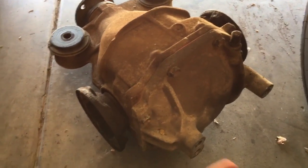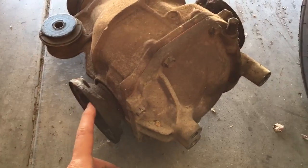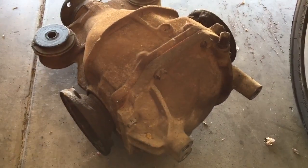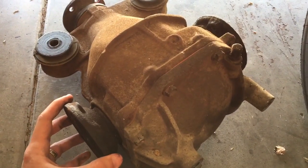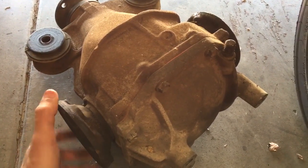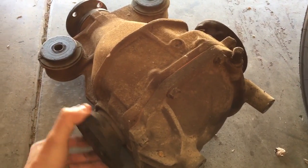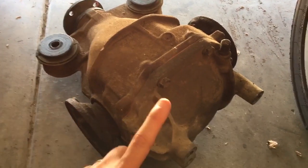Under extreme power or extreme torque, one will dominate more than the other. Now, I know this is an open center — if you were to grab one of your stub axles and turn it anti-clockwise, the other one will start to turn clockwise, in the opposite direction. That's the easy way to tell if a diff is an open center: it'll do this.